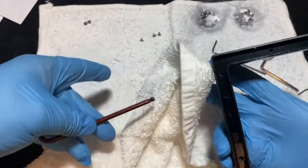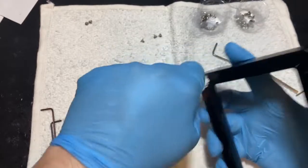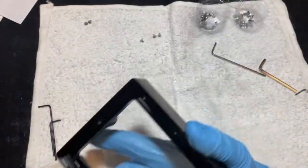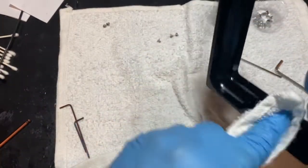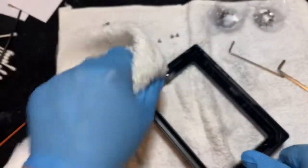It's a pretty quick job to get this done. For the frame I've already sprayed it down. I'll put an Allen wrench into the towel to help get it in there because my fingers are too big. Get the initial wipe down done, then spray the rest of it. There's some glue to the inside of the vat and leftover resin — get that all removed, get it cleaned up, and let it air dry.